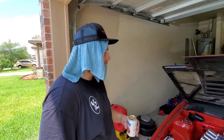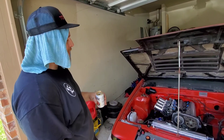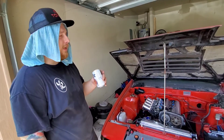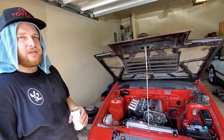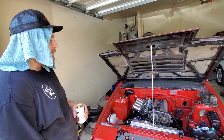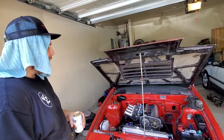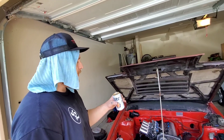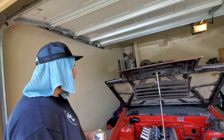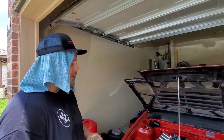Looks like we've got a lot of corrosion in the dash harness. I'm not super surprised, a little bummed but not surprised. We're going to go inside and weigh out options on whether I can find anything used, but honestly I might just try to build something new so I don't have this issue again with a used harness. That's about where we're at — we're getting a ton of resistance all over the place, all stemming out of the fuse box on the inside.